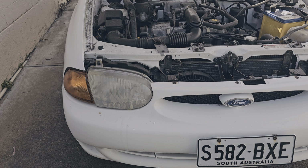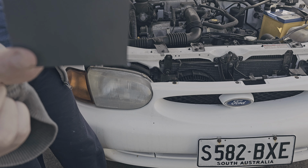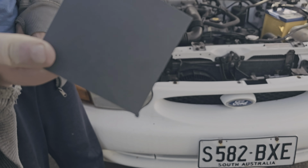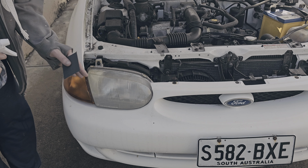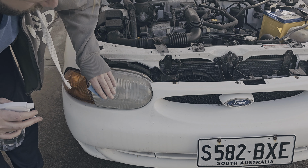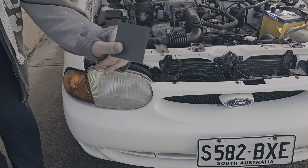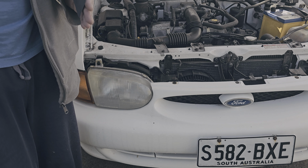On to the next. Okay, ladies and gentlemen, this is how much of the 1500 sandpaper that you should use. And we're going to spray down the car headlight again and give it a good polishing. This is a final cut, and then we go on to the 2000 grit sandpaper. And I'll give you a before and after.